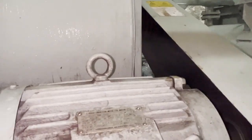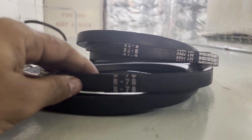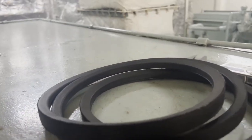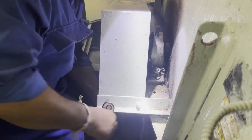Before changing it, you have to stop the AC unit. You can see the belt is wobbling too much — it is always better to change the belt if you find this kind of issue while running. This is the belt we are going to use. There are three belts needed for this job. The belt number is usually written on top; here it is B78. First thing is you stop the unit, then you remove the safety cover.